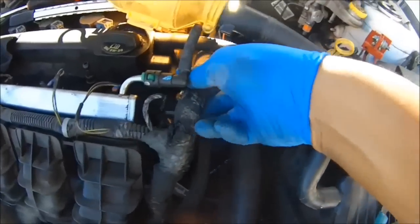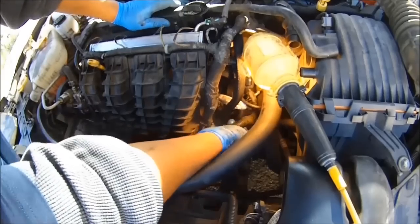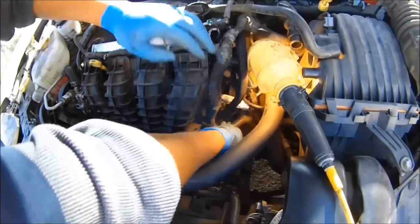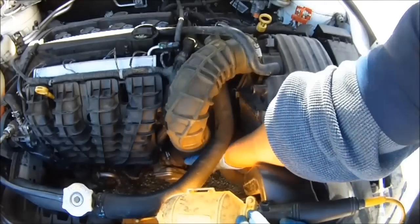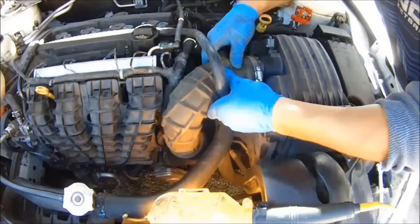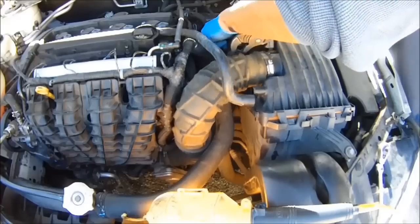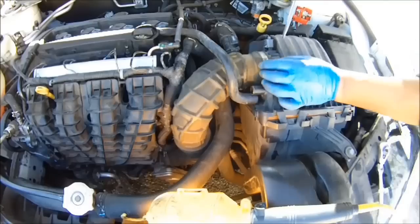Get this in here — put that up, plant that down, one more down here. On the mounting bracket attached to the throttle body, get that on. Now get the bottom on first — do the hardest stuff first and get that out of the way. Good to go on the throttle body. Get the top on — air cleaner housing. Good to go. Get this in there, pinch it, line it up the way you want it. Tighten up the clamp — that's a done deal. And we're going to start it after this.